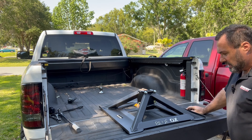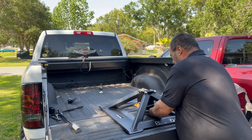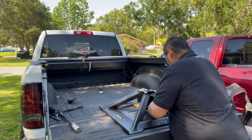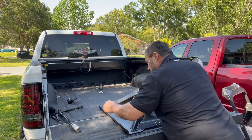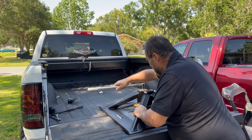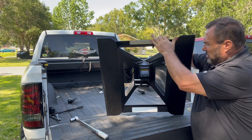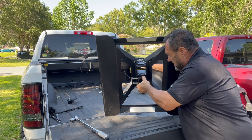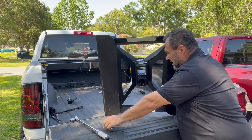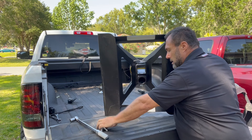As I mentioned earlier, this thing's a lot lighter and easier to maneuver than a traditional fifth wheel hitch. Underneath here, a couple pins — undo the pins. Loosen up your top bolt. As you loosen this up, it lowers the stem at the bottom; turning that bolt actually lowers this down. It brings it down over your hitch, then you get the pins out. As your ball slides up in, you've got a pin on each side of your ball to hold it in place. Simple enough.